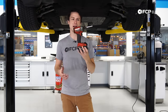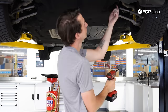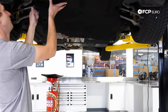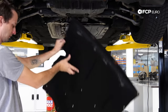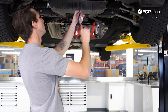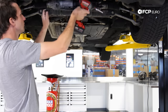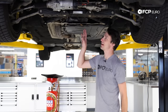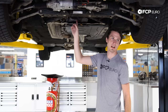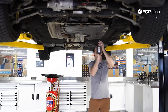Now we're going to pull the belly pan off this thing. I highly suggest having a little impact driver with an eight millimeter on it — it'll save you so much time; there are about 20 fasteners. Next we'll pull this little plastic guard pan off the bottom of the steering rack — same thing, eight millimeter fasteners. To gain access to the transmission we're going to pull the transmission guard off, which makes it a little easier to lock the flywheel down. Eight millimeter fasteners except for one which is a 10.